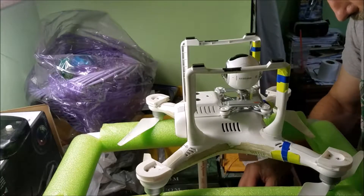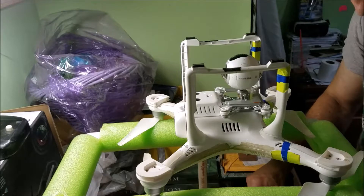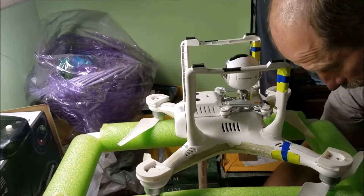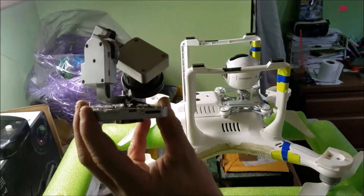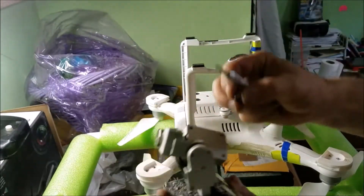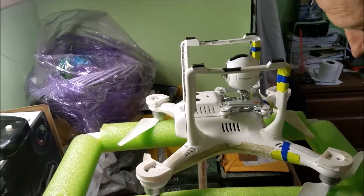See, a little bearing shot out of there — there's a little bearing that the gimbal rides on. There's a screw in there and you can take this whole thing off. Especially if you're just going to replace it, all you have to do is pop that off. You've got a little bearing here that helps support its rotation, and it fits inside of there.